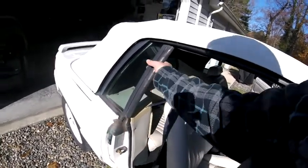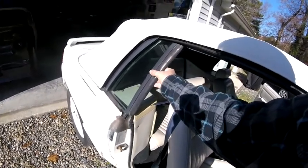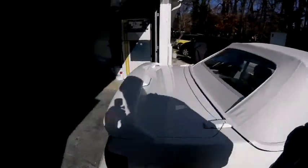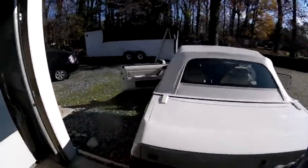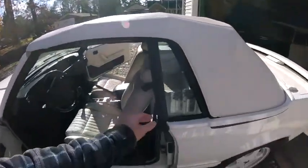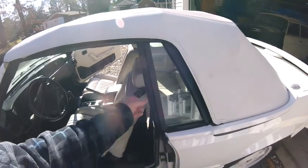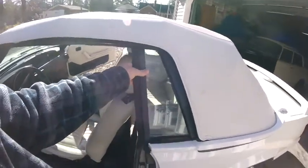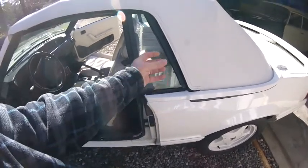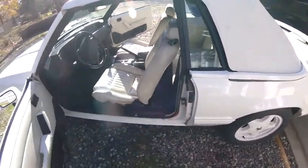These windows don't work. This one's nice and solid but doesn't go up and down — I think the motor is bad or it's the switch. And then on the other side we have a different issue. On this side it doesn't go up and down either, and it isn't attached. I've learned that there's a pole-type regulator in there and most likely the problem is that the mount on the bottom of it is broken.